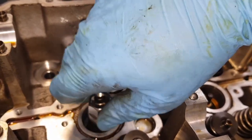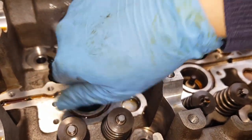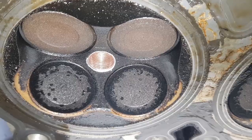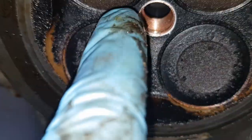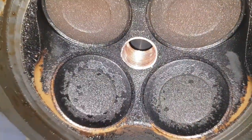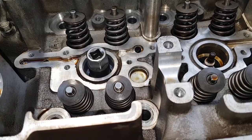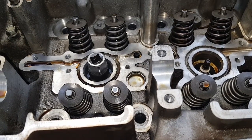With that all done, I can screw the spark plug back in and it now fits very nicely. Whereas it had been cross-threaded before and wouldn't seat properly, it now screws in very nicely — job done. If this was a working cylinder head I'd be cleaning it up underneath and putting it back on the engine. With the insert finished, I've turned the head over to look underneath, and there are a couple of little bits of metal sticking out on the edges that I'd want to clean up before the head goes back in the car, as they'll most likely fall off if left. But that's the process for how you fit a TimeSert as a spark plug thread repair — thanks for watching.